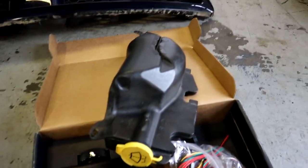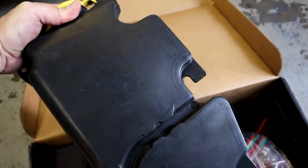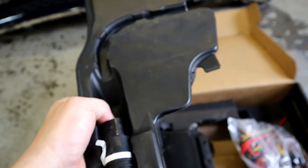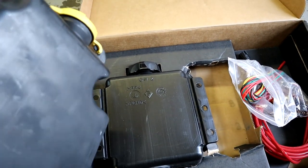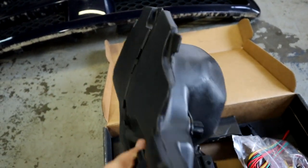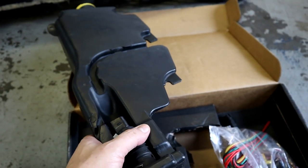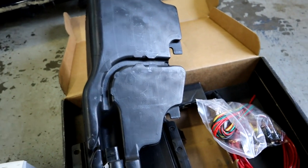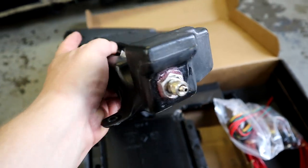I'm going to show you on the factory tank what we did. This is exactly what I did with Frostbite — I use the same factory window washer fluid tank for my meth tank instead of using the one they supply you with. You can use the supplied tank, but you have to figure out where to mount it, and I find it easier to just make your window washer tank your meth tank. You can still use it for window washer fluid, and the Snow Performance 50/50 mixture actually works really well for window washer fluid — not to mention it's a great de-icer. Anyway, on the bottom of the tank...